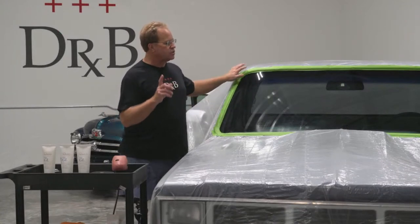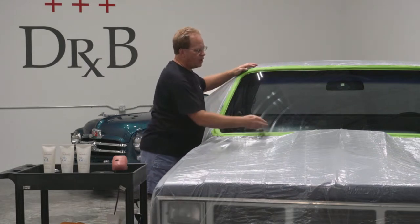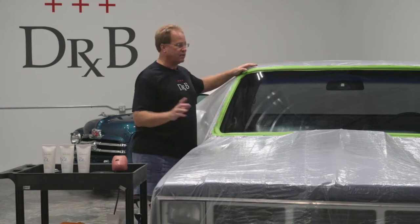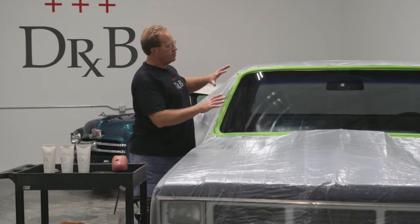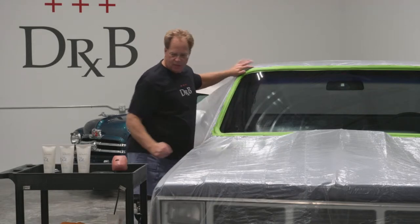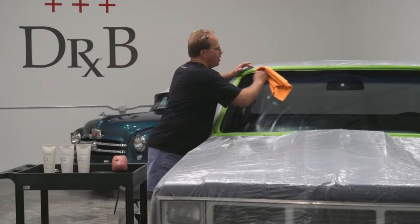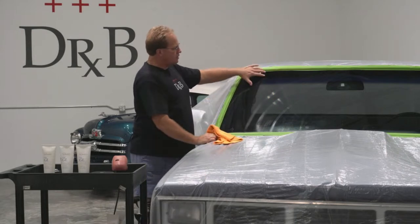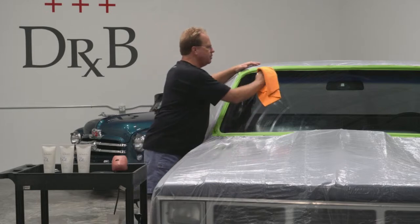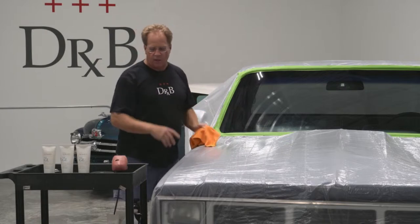And also, some cars, by the way, a lot of classic cars, they'll have chrome or stainless steel trim around the window, and you'll get that splatter up underneath there, and it's almost impossible to get out of there without taking the trim off. So, for me, the way I like to detail cars, I just want to tape this off, and I actually come back with a microfiber towel after I've secured all my tape, and I use the towel to really push this down hard. And the reason why is because once this lifts, say you get some water, some polish under, there's no way it's going back down again. So it takes a little bit of time to really push this down, and it's easier to push it down with the towel than it is with my skin. So that's kind of the prep work.